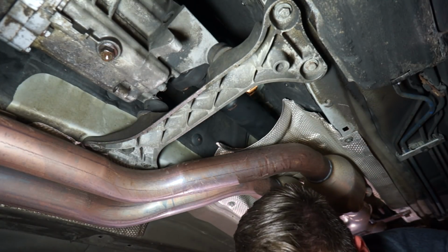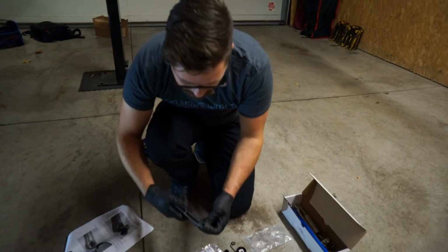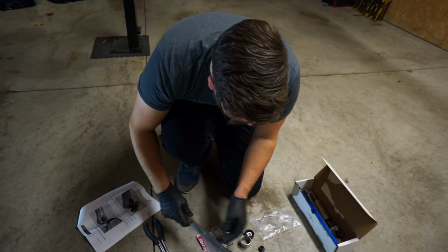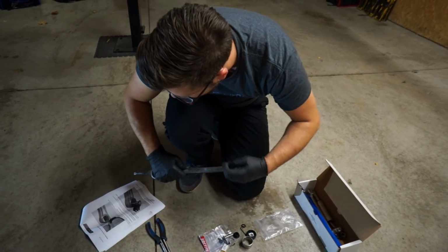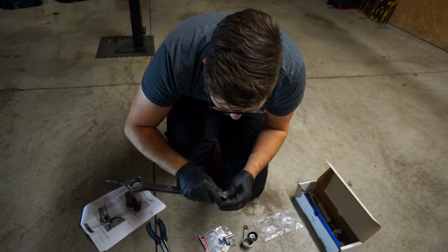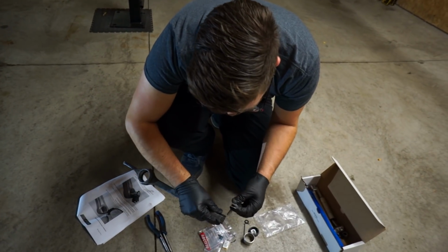Okay. Good. Now we've got to rebuild this thing on the workbench. We're going to take this old rubber bushing out of here, and UUC has given us Delrin replacements, which are very closely machined to fit in here. These just slip right in either side, like so. And now we're going to test fit this new pin.